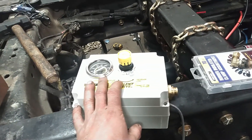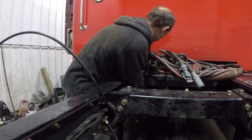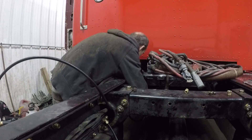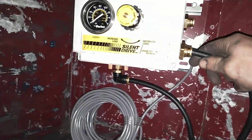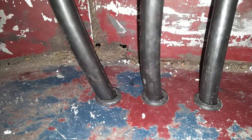I think I'm going to mount this under the bunk. So there's where we decided to mount our box. You're going to have to drill four holes in the floor, put rubber grommets in, and then we can start running our lines. So that's our three air lines run — this one's our supply line, this is the load bags, and these are the lift bags. They're all run through the floor with nice tight rubber grommets.